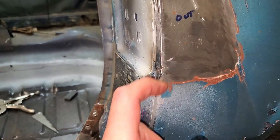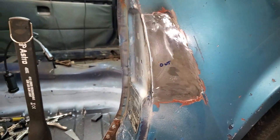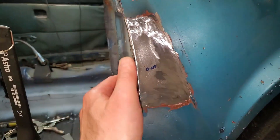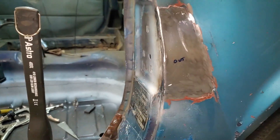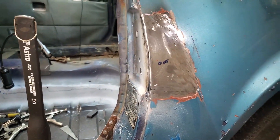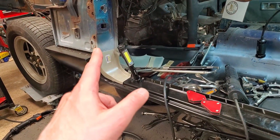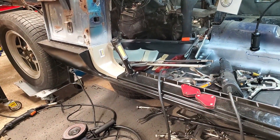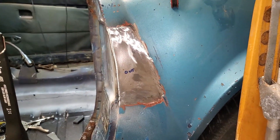I've got to do a little more grinding, but hey, I'm real happy with this. Now I've got to get the door back on and see how it's fitting. Because now that this curve is more normal and this panel is flat, it should be a better geometry. I do have a feeling that the A-pillar has warped or turned in a little bit, so it's going to require some adjustment. But I'm very happy with this. Thanks for watching.